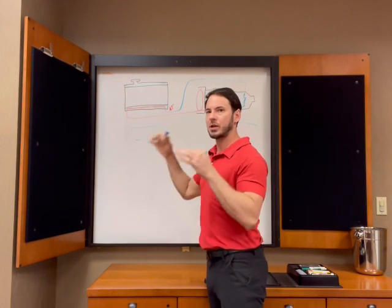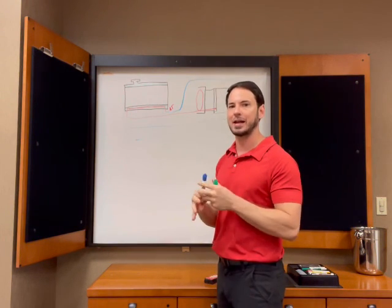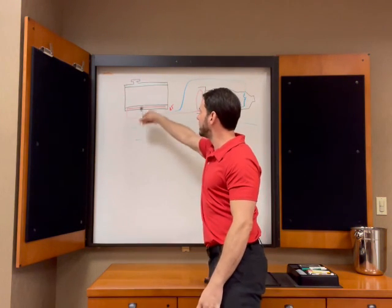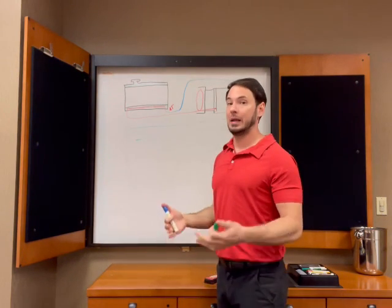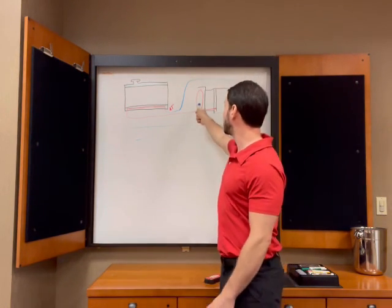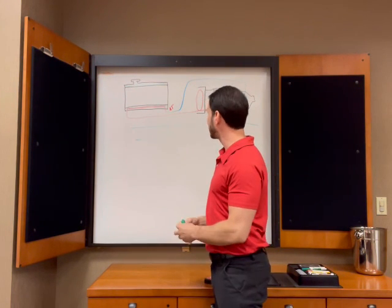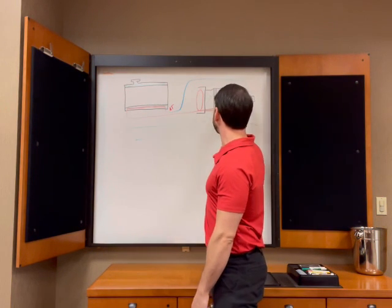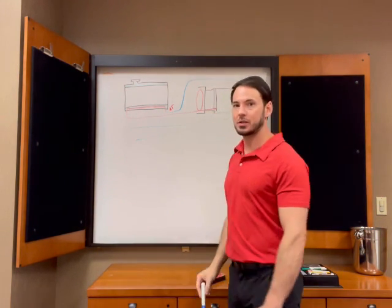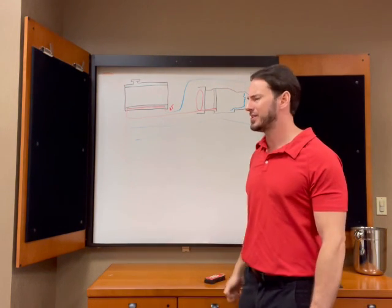That was meant to slow down the fluid, so the fluid going through it would slow down and interact with that screen, which then promoted more heat exchange in there. Cool, right? Not if that gets clogged with clutch material from a defective torque converter. So basically what we had happen is that this was blocked, like I said, and so the transmission was destroyed.